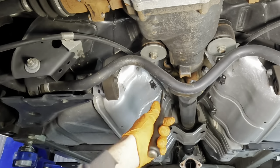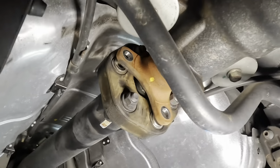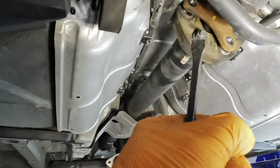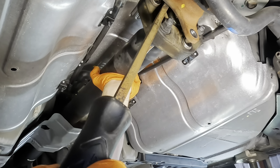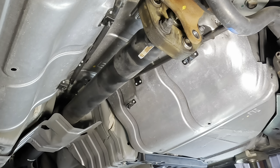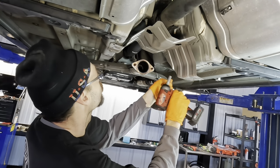So yeah, this shaft seems to have a pilot bushing or a pilot shaft sticking out for alignment right there. So I don't know if I can push this thing forward enough to get it out of there. How about a bigger pry bar? Let's do that first. Bigger shaft for more leverage. And that little shaft is longer than I thought it was. So, well, it appears we have no choice. We must remove the entire shaft, but that's fine. A couple more bolts, it's worth the effort.